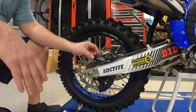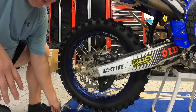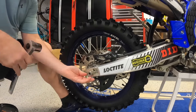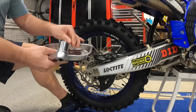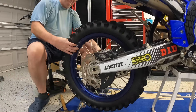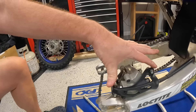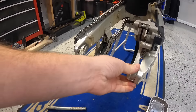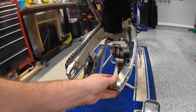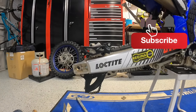There are a couple different ways you can start — you can just start taking the disc apart, or you can take the wheel off. I like to go ahead and get the wheel off and start that process. This is pretty simple; this is a 27mm socket. If we take a look here, you've got your outer guard. This thing actually works on a slide system, so when you move the bike forward and backwards when you're adjusting the chain, the brake actually moves with it — it's always in the same position. Let's go ahead and start taking these pieces apart.